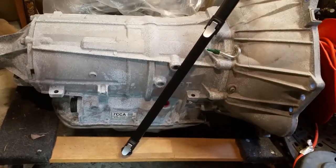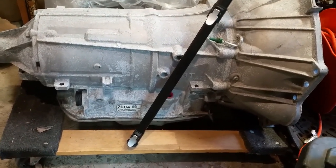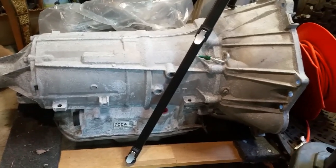I have a 6L80 and that's out of a 2017 two-wheel drive Silverado and it's flat burned up. The 6L80Es have a problem with the torque converters — the friction material delaminates from the actual backing plate and so it starts to slip. When it starts to slip it sends all that metal and debris down into the pan. It goes down into the pan and the filter picks it up. Eventually the filter gets plugged with all those fine particles, so it starves the pump for fluid pressure, then the pump scores the inside of the pump housing, and you lose fluid pressure and it burns up the 4-5-6 clutch — and then it just cooks itself after that.